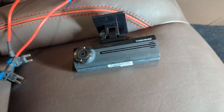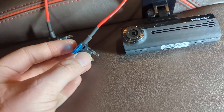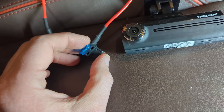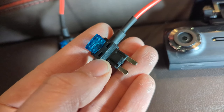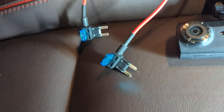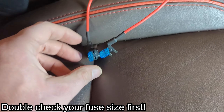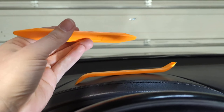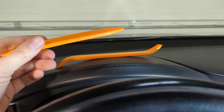What you need to do this — other than the dash cam itself — is some of these fuse taps. These are really handy because you remove the fuse from your passenger fuse box and replace it with this tap. It lets you keep the original fuse in place and add a fuse for your dash cam, so you tap into the vehicle's power without sacrificing the fuse for the accessory. You can get these on Amazon. Also pick up some spare fuses. I also have these plastic trim tools — auto trim tools — they are so handy to have. You can manage without them if you wrap the ends of a flathead screwdriver in electrical tape so you're not doing any damage, but I find these to be super handy.